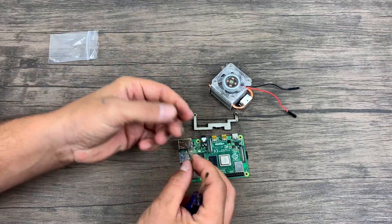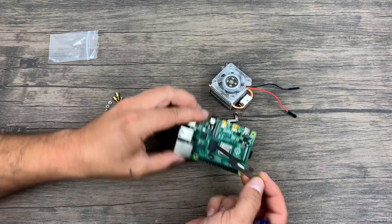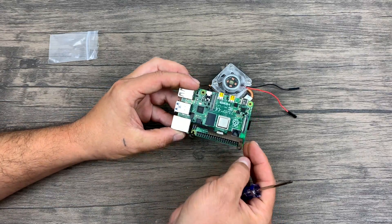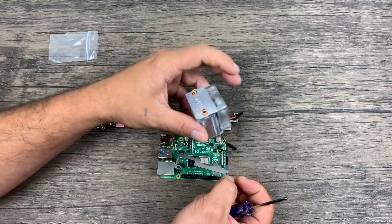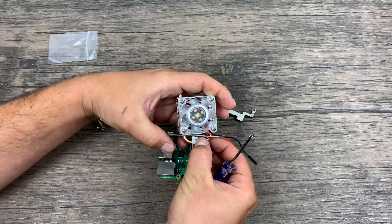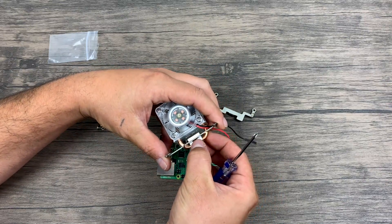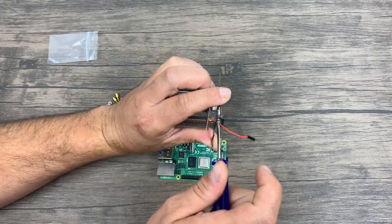You also want to make sure that the fan is facing away from the GPIO pins and towards the power end and HDMI. I initially assembled this with the fan facing the GPIO, and I just can't access it that way, so I had to swap it out. On the heat block, there's a hole in each side where the mounting bracket is going to mount with a small screw. Make sure you don't over tighten these — you really don't want to strip out this aluminum.